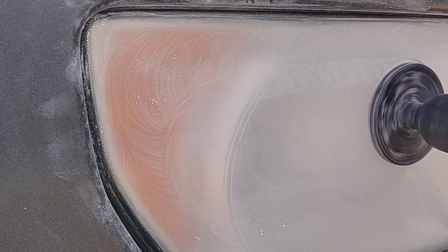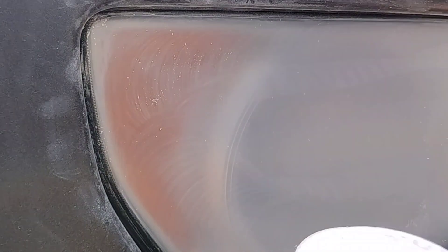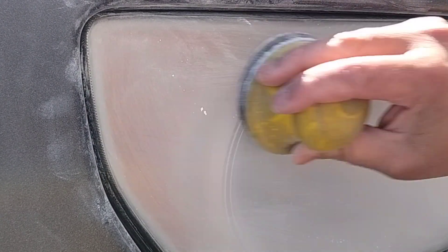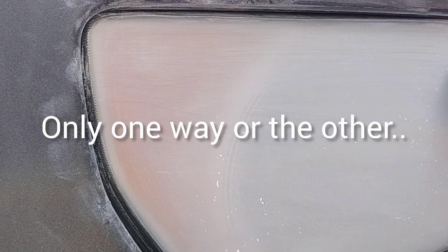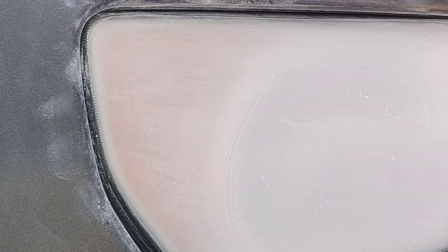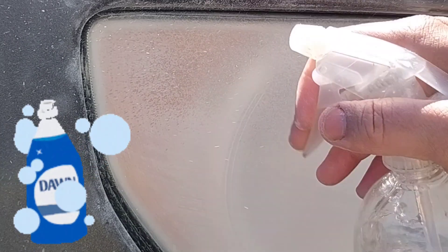Normally what you could also do is strip around the area of the vehicle. They sell paint strippers — not as aggressive as it sounds. Isopropyl alcohol, things like that will work. But they sell products already made for when you're waxing or washing a vehicle and you want to strip the wax, clear coat buildup, or ceramic that's gone bad before you start fresh with a new coat. An old school hack and easy way, if you don't want to spend money on those, is a little bit of Dawn soap mixed in a spray bottle. Spray around that light — it will strip all that off.